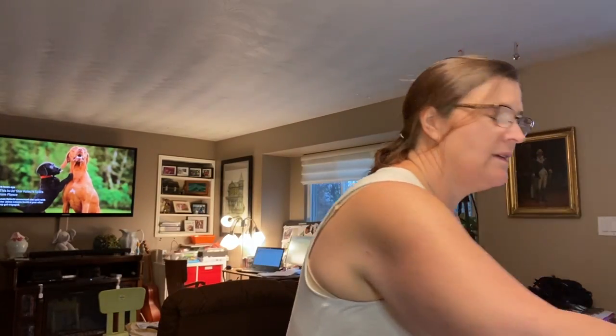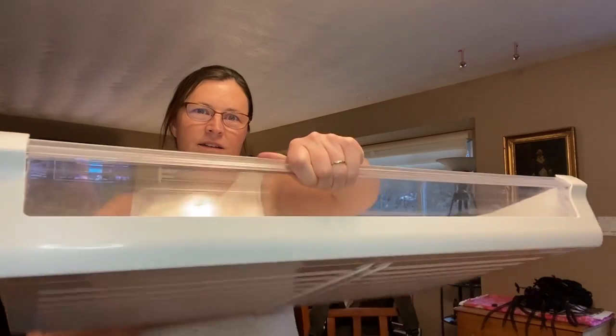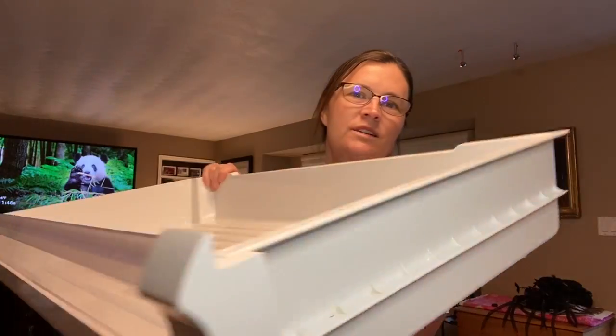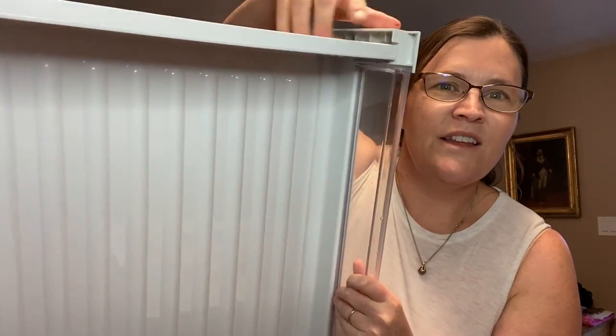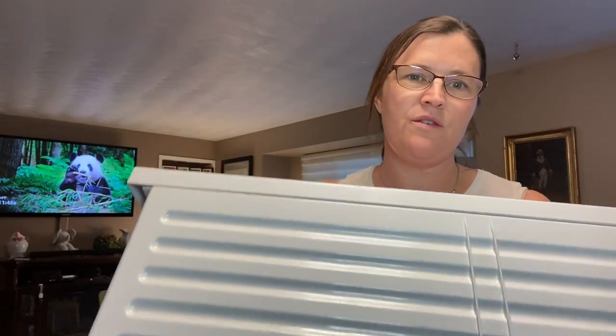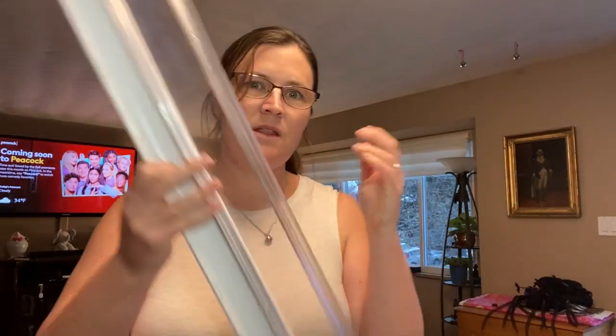I'm going to show you my drawer. I have my gigantic deli drawer — it has the white plastic with this front piece on it. I just cleaned this, figured out how to do it, and put it back together just so I could show you how to unassemble it again. See the edges, how they're molded? They don't really want to come apart. So the trick is to go from underneath in this little groove. You take your flathead and just kind of pop it off very gently — you don't have to leave any scratch marks. And it pops right off — see that? It comes right off.